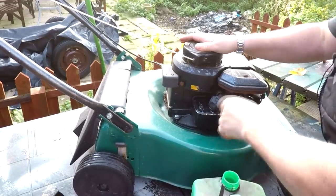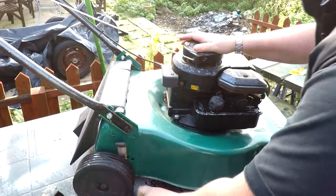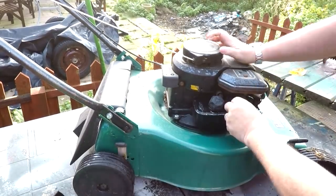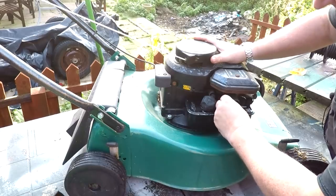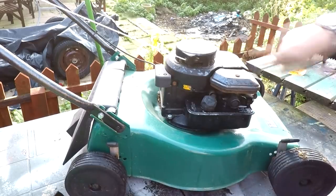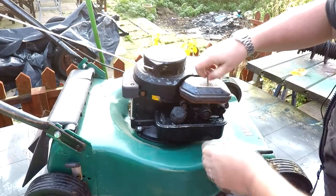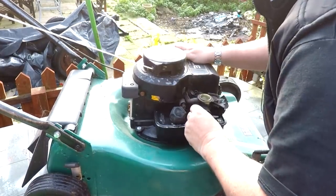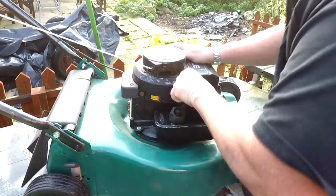As you can see, that's why I lacquer these decks — because normally if you spill petrol all over them it starts to peel off, but this has got a 2K lacquer on it so that's why it's not peeling off. Let's give it a prime. Oh, that's very slow. It's quite cold out here, probably about 6 degrees centigrade. I can't hear anything filling up. I'm just going to take the top off to see if it's squirting fuel. I'll take the air filter off. I can't remember if I put a new one in here — I'll just clean the old one. We've got nothing coming through there at the moment.